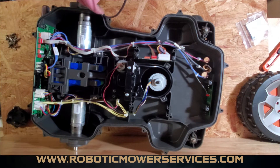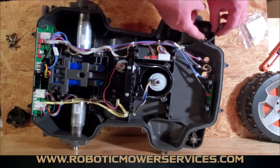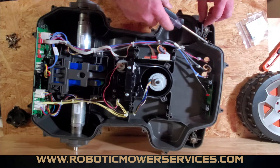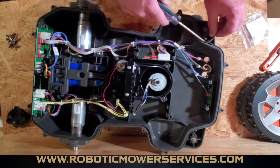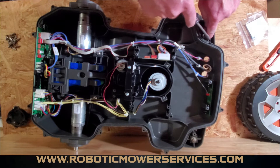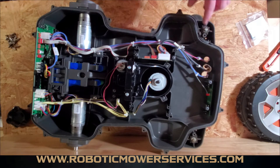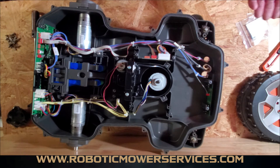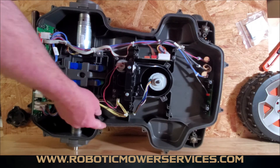Now you're going to come around to where you started, and you're going to go over top of the first end that you started with. You're going to go right over top of that, and then take the excess and put it down in this channel right here. So right there you've got two layers on top of each other, and you might be saying, 'Well, that can't work — it's going to be higher here, it's going to take more to smash that down.'